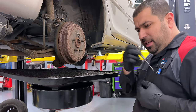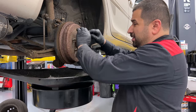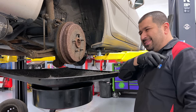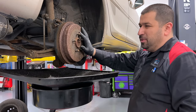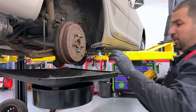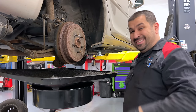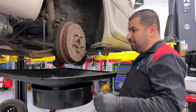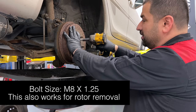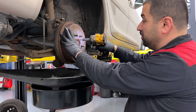The first thing we're going to do is take our little inspection plug off. This is where you adjust on these. On the Camry and some old Siennas, it'll be in the front; everything else will have it in the back. Take it out — we're going to reuse it. Let's take our drum off. I put an oil drain pan down so we don't get all that dust on the floor. Take a bolt — I'll put the size on screen — same bolt you use for rotors if you want to pop them off. We're just going to pop this drum off.